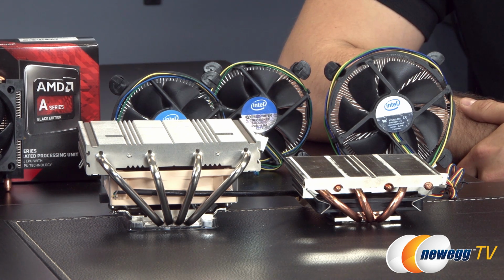So those are some of the benefits of third-party aftermarket heatsink fans. Again, better cooling, which you can often translate into more performance by allowing you to overclock your processor, and then also sound generation, or the amount of noise that they create, is much, much less in many cases than with the stock heatsink fans. And using larger fans as well, like the 120 millimeter fan over there on the Sigmatech, larger fans can move more air while they're spinning more slowly. So larger fans will often be quieter as a result.